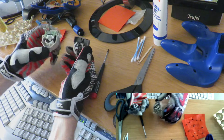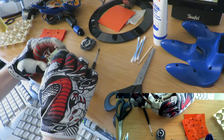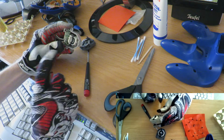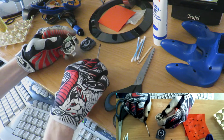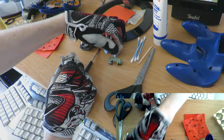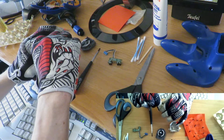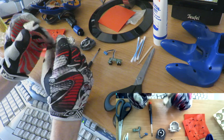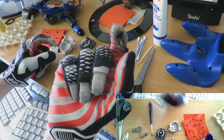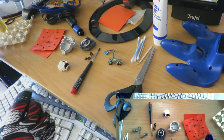My stick is still in a very good condition. Clean the bowl and use a PC duster to blow the rest of dirt out. If this black plastic mechanism is worn off or damaged too much, like in these Mario Party hardcore controllers, then you need some component glue to fill it up, or other methods. But in my case it's still like new, so no glue necessary.